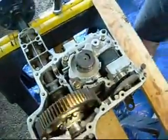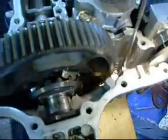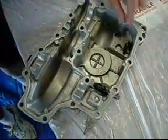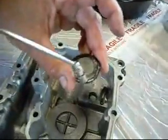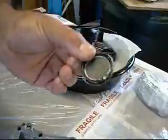Next, I want to demonstrate that the spider gears do seem to be in good shape. More importantly, looking down into the bottom of the case — actually the top of the case — with my magnet I'm getting no shards or ferrous metal filings. I feel pretty good that the gears are not the problem and simply that it's the pump and motor giving us fits. To further bolster that opinion, the magnet is almost completely clear — just some sparkles. The filter, other than a little sealant, is relatively clean. We can see through it.